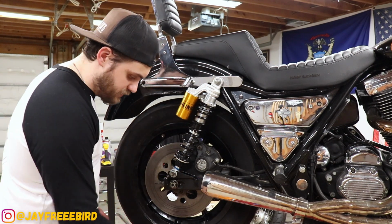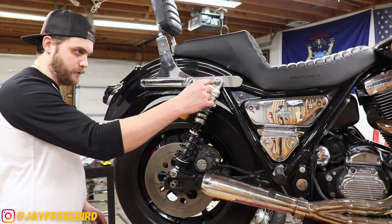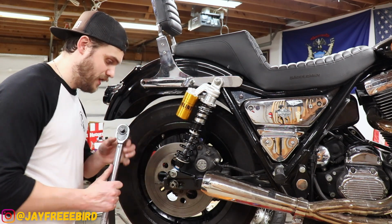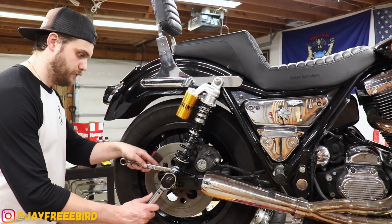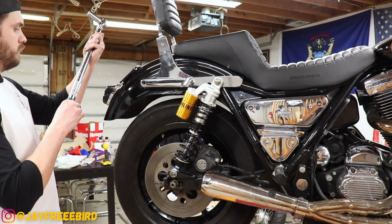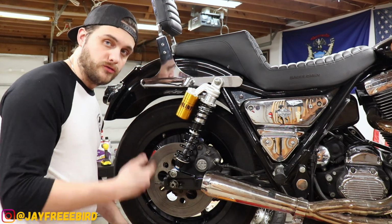All right, we're gonna torque these down. Bottom bolts are different from the top bolts on the torque specs from the book. 35 to 40, 33 to 35 up top. Gonna lock that down now. Starting off with 35 for the bottom. Go, just at 40. There, do the top. 33 to 35. Now we're gonna bump it up to 35. All right, good to go. Let's jump to the other side.